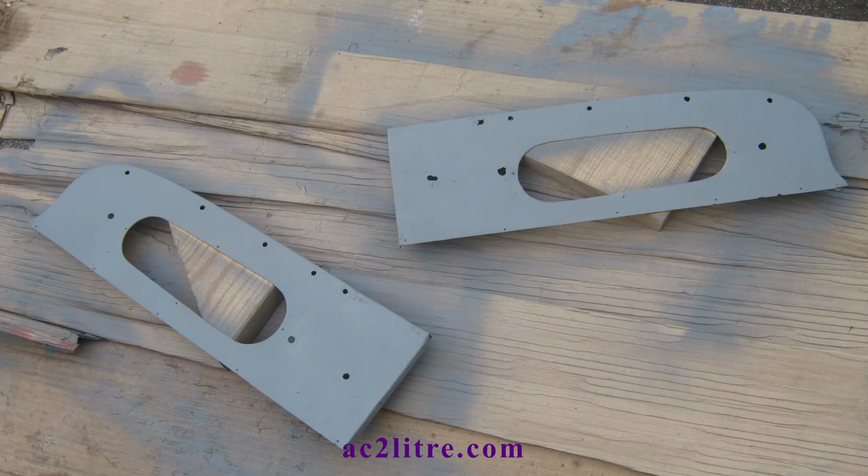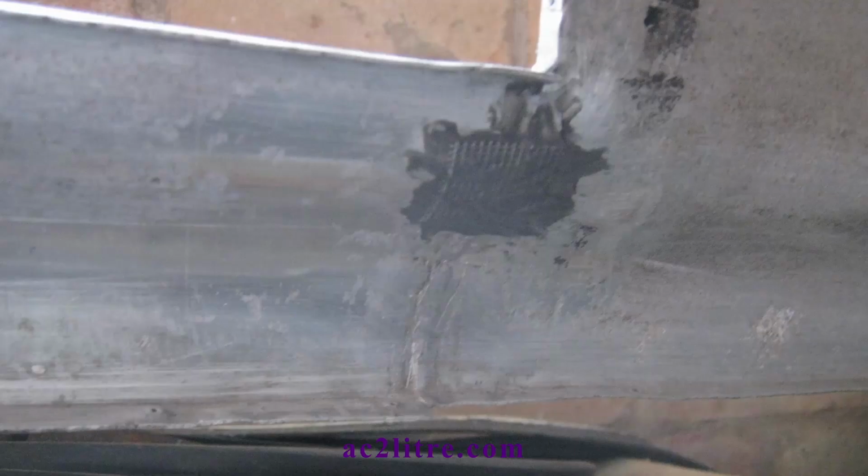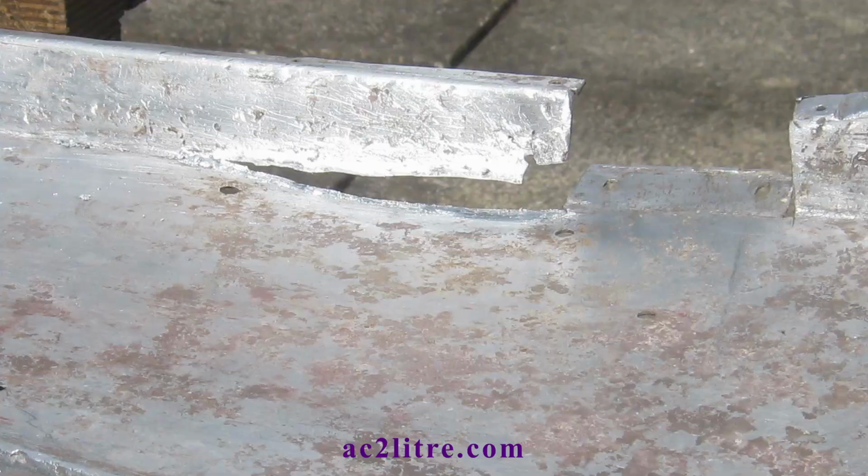You can remove the oxide with abrasives, but the oxide starts to reappear straight away. However, with repairs on a tiny area, I think it is viable to abrade the surface, clean it quickly and then apply an epoxy adhesive suitable for this purpose. It is also advisable to degrease the surface before abrading.